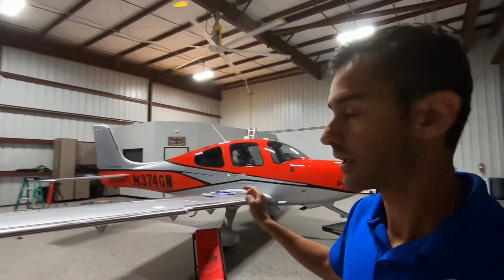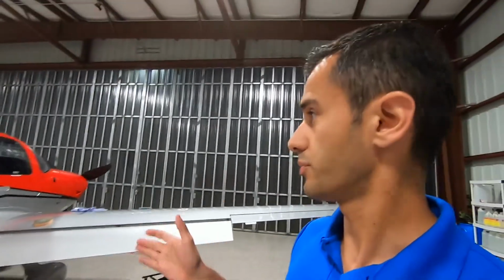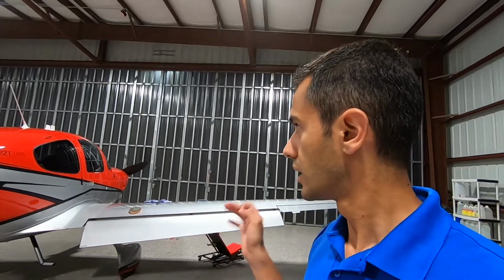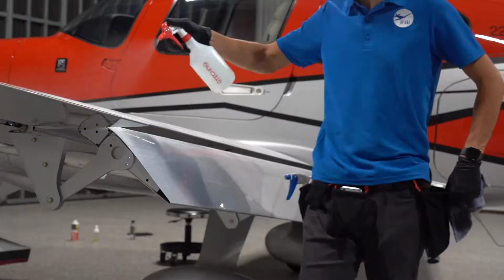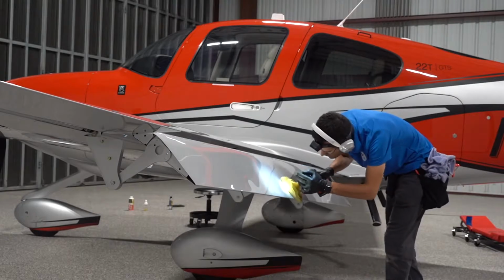Fuselage is polished. It looks beautiful. A lot of the sanding marks came out, swirls came out. It is super glossy. I just got to get under there, get the underside polished, and then we're going to panel wipe it and coat it. At least that's the plan. It's 8:20 right now. Still a little jet lagged. My mind says that it's 10:20, so I'm a little bit slower, but I'm going to try and get it coated tonight, at least try and get the fuselage coated. Then tomorrow, all I got to do is wings, top and bottom, and then horizontal stabilizer bottoms. So we'll see how far I get, but I'm gonna get underneath there, polish the underside, panel wipe. That removes all those oils from the polishes to make sure that we're not leaving behind holograms, and then coating.